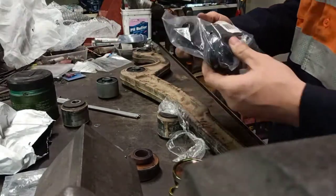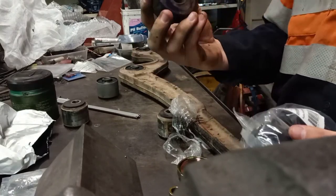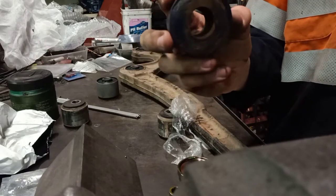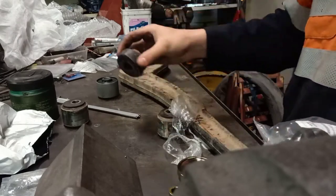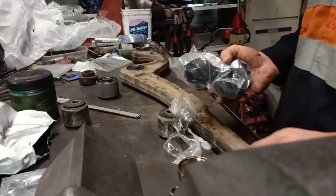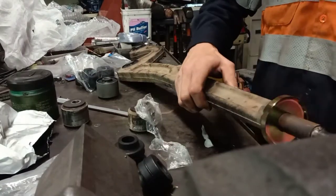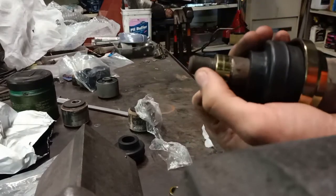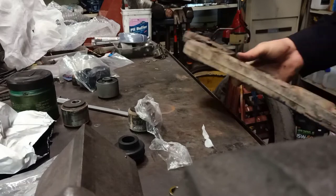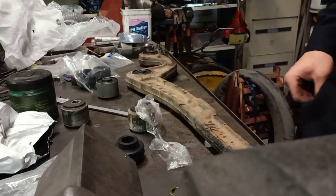These are the new bushes for the chassis end. The old ones are pretty hard and that one has actually ovalled out, which won't be very good. That's what the plasticky bushes are no good for — they get hard and then hold their deformed shape. I'll chuck the new bushes in, put the arm back in, and do exactly the same for the next arm on the driver's side. Always anti-seize the threads — chances are you or the next person who buys the car will be replacing the bushes again.